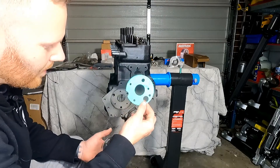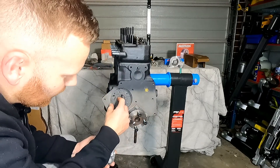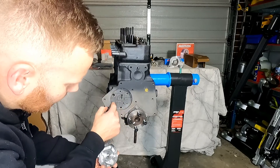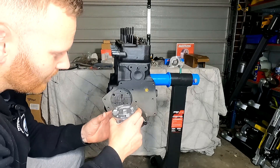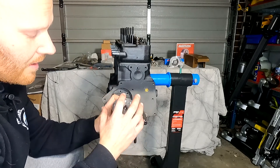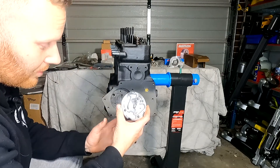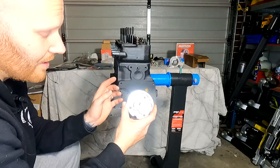Next part of the build is to install the oil pump gasket and the oil pump. I'm using the upgraded oil pump gasket that is available at Minisport — check it out on my channel and in the link in the description. This goes in dry, you don't need to fit any lubricant or oil to it. Make sure you line it up with the three bolt holes — two at the bottom and one at the top. Before you install an oil pump, make sure you check the tolerances. Beforehand, make sure you either prime it with oil by pulling it apart, or use Vaseline like I generally do, or pump some oil in and spin it around until it's worked all the way through. That'll ensure the pump is primed and ready to go the minute you turn it. Running this gasket is also going to help with priming the pump a little bit sooner. It's also advised that when you start an engine for the very first time, leave the spark plugs out, crank it over until you get oil pressure on a gauge, and then reconnect everything and start it up.